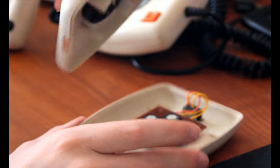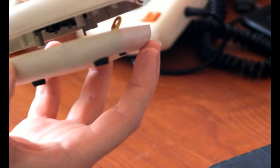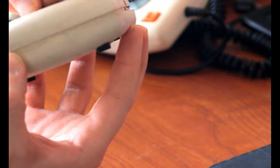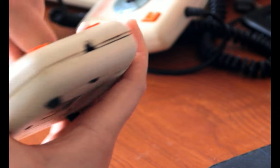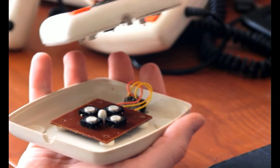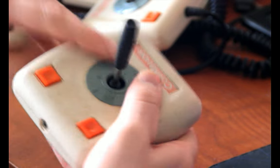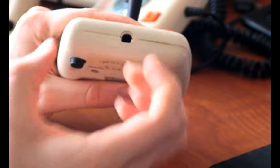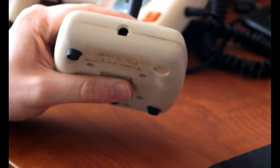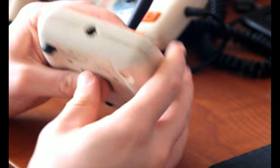And normally there are switches in here already, so I'm skipping that step. But you pull it flat, and then you have the circuit board aligned down below. It doesn't have to be perfect, because as you're sliding it around, it'll fall into place. It might take a couple tries, though. Oh, I have it upside down. Yeah, so I have the stick being pulled up still most of the way. And that's because you can't re-adhere the circuit board. Well, you maybe could once, but you won't be able to repeatedly remount the circuit board with the plastic melted tabs like it originally was.